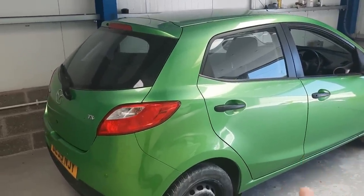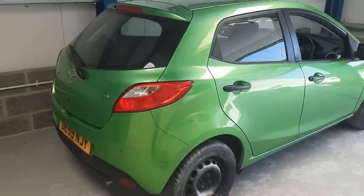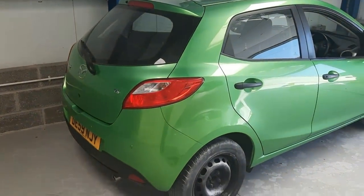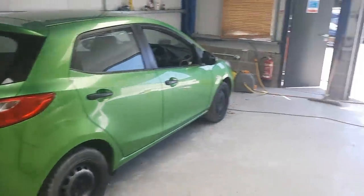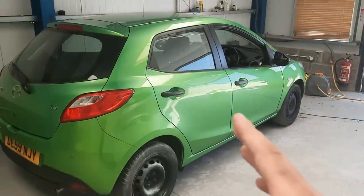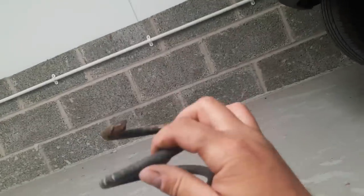This one is sold and needs to go down for its MOT, but I had to pull it back to get the paint done as it's the only day Davy comes in. It's got a broken rear spring which has just arrived - I'm going to try and fit that myself. I'll jack it up and see if I can lever it out and get the spring in, because at the rear those ones are just free-floating rather than being on a strut like the front. I managed to get the lever bar in and pull it out after jacking the car up - annoyingly this one is only broken at the very very top.